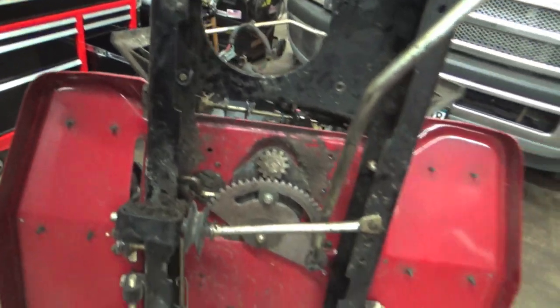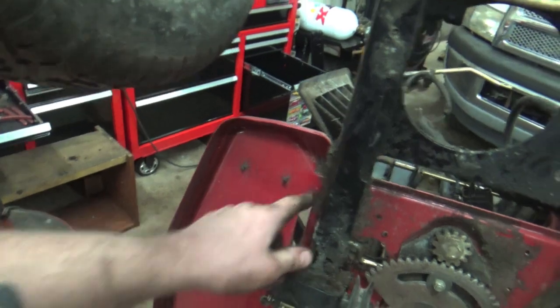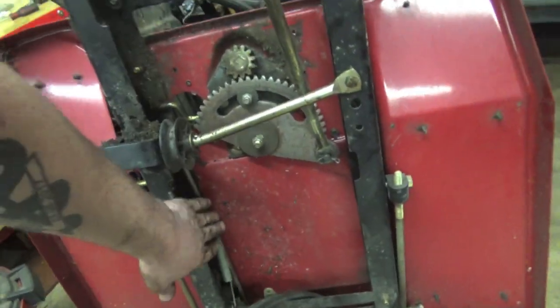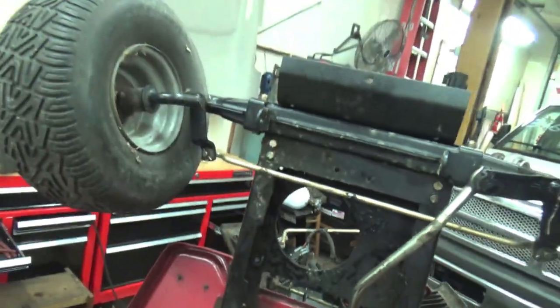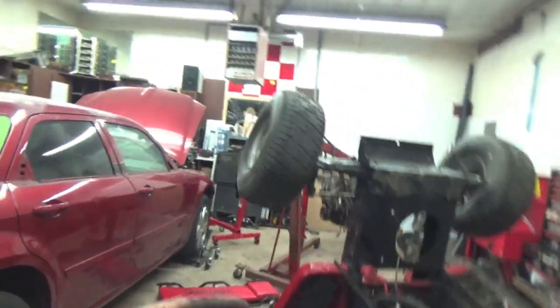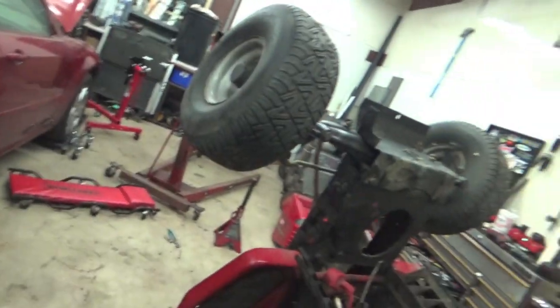We are gonna have to lengthen the front — I don't know how much — but to keep rigidity of the chassis we'll probably run our quarter inch two-by-twos to about here, maybe tie in a little bit more, maybe box this stock C-channel in. I don't want to mess with all the mower drive and everything, so we'll probably just cut it off where the motor used to be and lengthen it from there. I think we're ready to hold the motor out in front of it and figure out how far we're gonna have to actually lengthen the front of this chassis to get that motor and a radiator to fit.